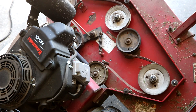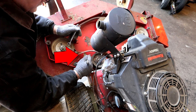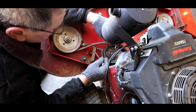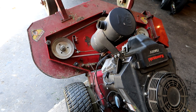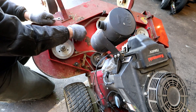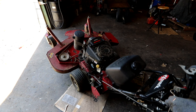That is your deck belt. It's a little tight, so we're going to adjust the belt tension a little bit, and then we're off to mowing. This is the belt tension adjuster — you take loose the locking nut and loosen it up a little bit. There you go. And we are good — drop the mower deck back down.